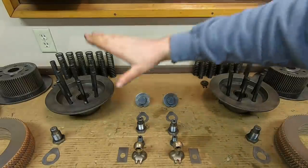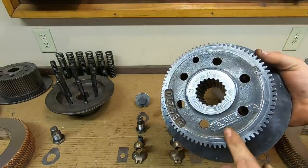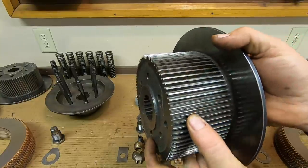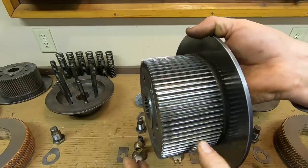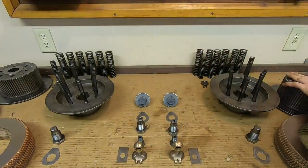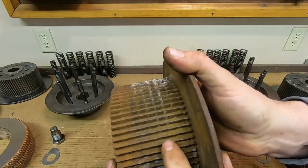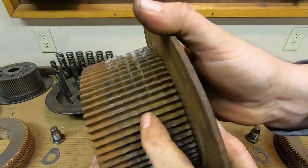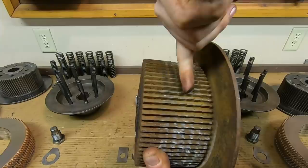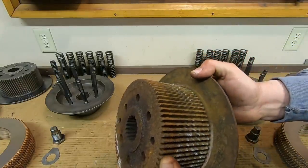You can see with the GoPro how we actually displace some of the metal just over the top of that set screw on each side — everything looks good, and of course repeat for the other side. Now we look at the center hubs and you really want to assess these: make sure none of those through-holes are getting too oblong, make sure the splines in the center are good, and make sure these splines that the steel inner toothed discs engage with are all good. We can see some faint witness marks, but these are as close to new as you're going to find in a D2. Just for reference, I cleaned up an old hub from 2115 and you can see how much wear is on those splines — some get pretty skinny, just about worn through — so that one is shot.